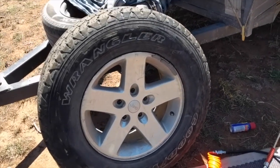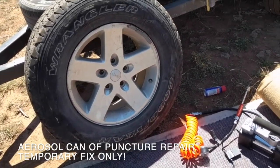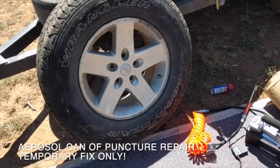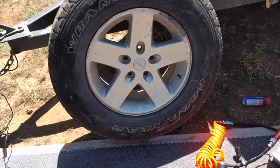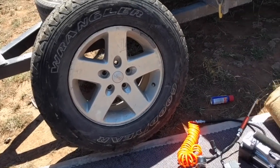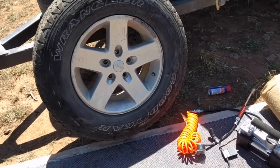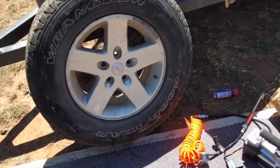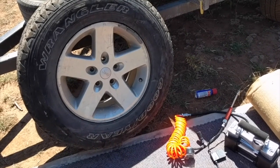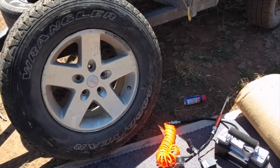I've put in some of that fluid to try and fix the leak from the inside — it's kind of a quick stopgap. If it's more serious then I'll put in a puncture repair bit of rubber. But for the moment it seems to be holding air. I put the puncture down on the bottom so that the liquid is being forced through the gap. It's holding air, about 25 psi now. So we'll see how it goes — I'll give it about 10 minutes and then check it again.